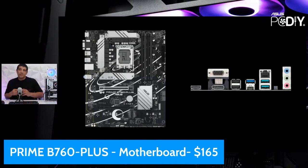So B760 is going to be a solid chipset. It's great, I think, for general users looking for general productivity, maybe a NAS, a sandbox, maybe coding, entry-level gaming is definitely an option, general content creation. You don't necessarily have a focus on the highest level specifications or overclocking support for the CPU. You can, of course, run overclocked memory configurations, and you have to count relative to warranty, heat, power, the different factors that come with overclocking. B760 does allow for overclocking the memory, so that is an option you do have available on this platform. But it's a nice solid set of foundational specs here.